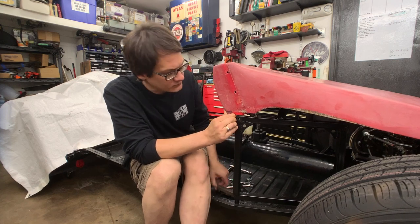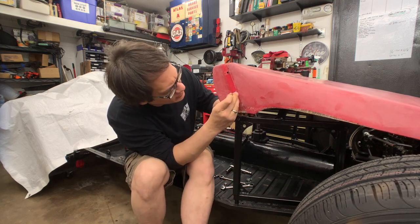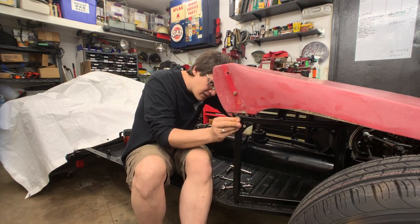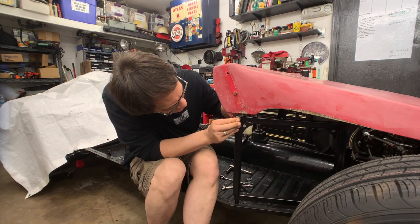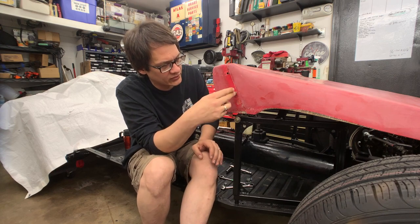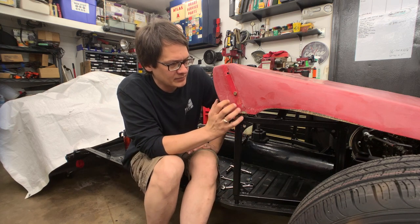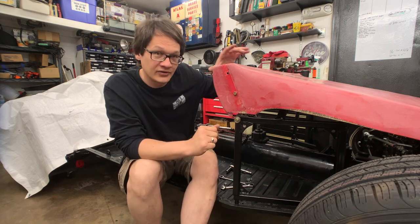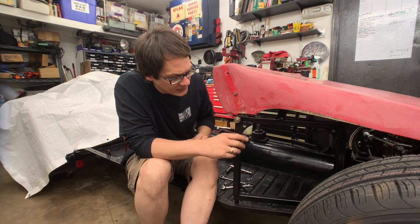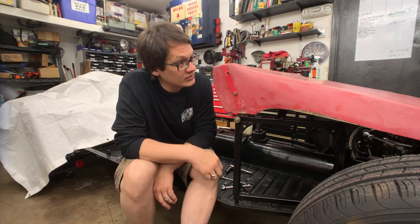With the hood up in place, we take the bracket and slide it up in here. There are a couple of bolts that pass through to hold the windshield on — one slides in from the side, and another comes in from the front up top. When this bracket is bolted tight and the windshield is in place and bolted tight, the hood will be completely solid. The hood is isolated from the body, so it's no longer part of the body structure — no worrying about support issues or breakage.